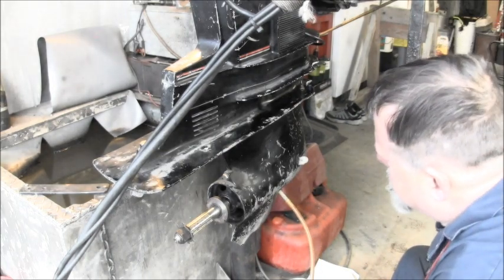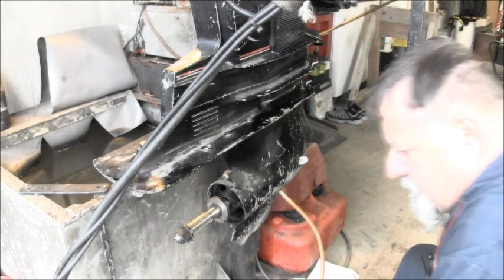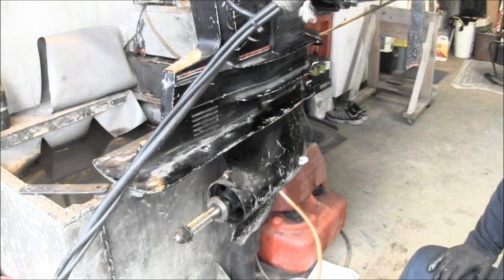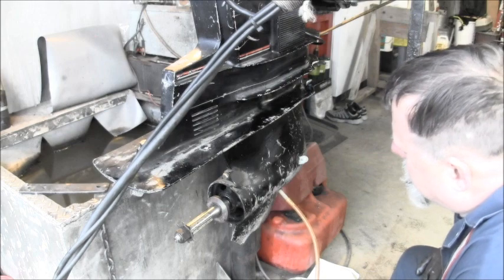Now I'm going back to pumping the 80, 90 weight gear oil in there. But yeah, that hack there about putting a little bit of Lubriplate in there, it ain't gonna hurt anything. And if a little water does get in, it's still gonna help protect those gears, bearings.